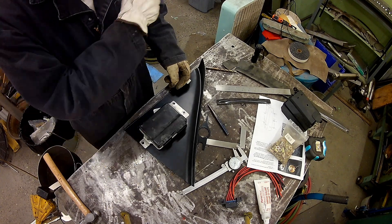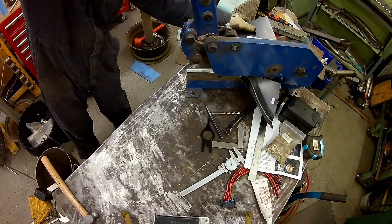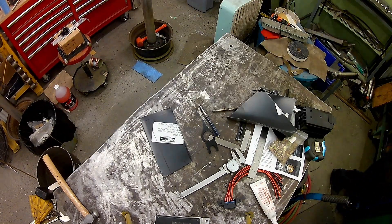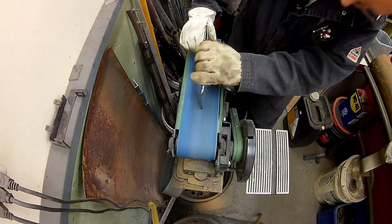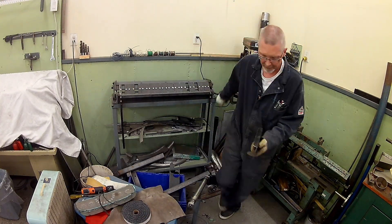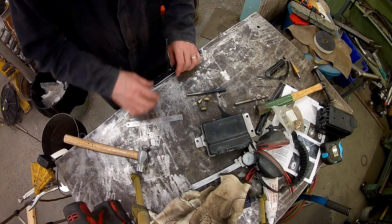Making a bracket for the drive-by-wire throttle actuator. This looks like a piece of a fender patch which I did not use. I keep everything, because you never know. Got one of these hand shears — I picked this up at probably Princess Auto, could be KMS Tools. I never bolted it down onto a bench because I don't have any benches big enough, so I just vice-grip it to my horizontal bandsaw. Belt sander to smooth off all the sharp edges from cutting. I love nutserts and punch holes. Sheet metal brake — I have a set of free plans on my website if you want to make yourself one.